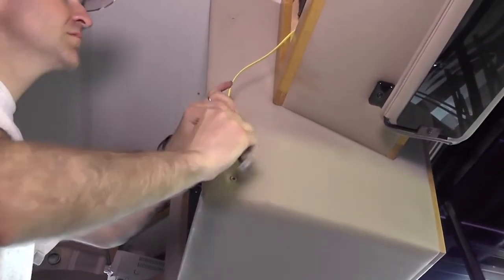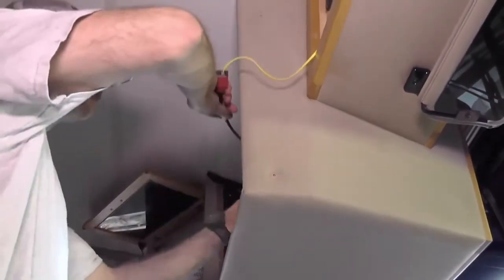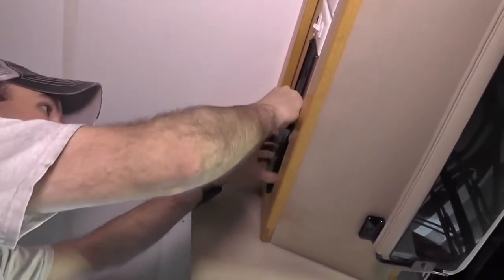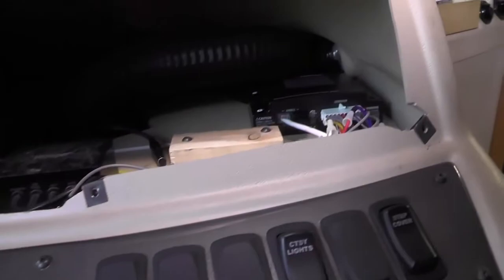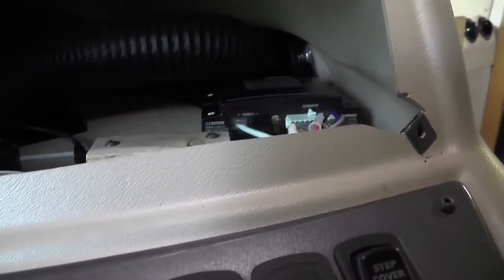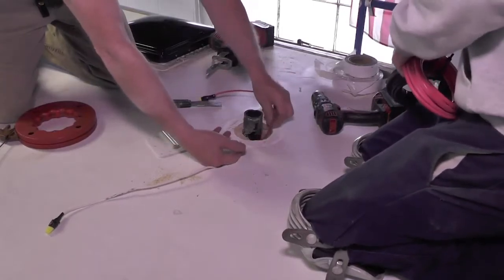While we're checking wiring, we also hooked up the adapters to the RJ11 wiring that was existing in the coach so that we could put the control panels in. And we opened up the dashboard and the overhead compartments so that we could run additional wiring and also install the Xantrex Auto Gen Start. This is a 2005 Newmar. It did not have Auto Gen Start already. So we found a way of putting it in here, and to be perfectly honest, it took quite some time to get the wiring just right for that.